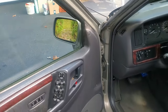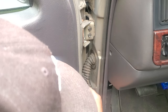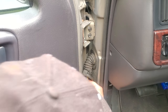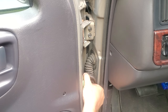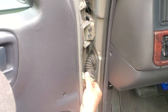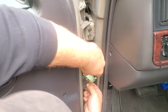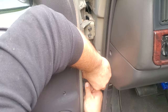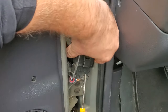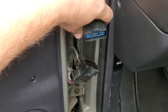Before I start welding, I'm going to take off the whole driver door. First thing we're going to do is unplug the door, because that helps a lot. There's a little rubber boot over this little clip — I'm going by feel. Got that little white collar up here, and in the door there's a little black plug. Used a little screwdriver in there to get the clip for the door harness disconnected.